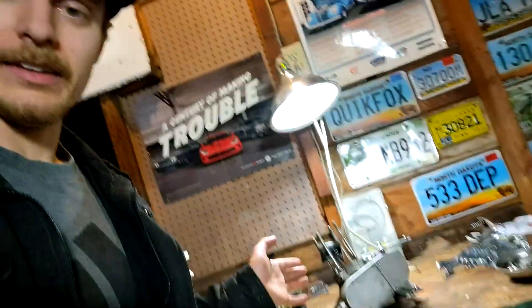That's the end of the show, and that's also the end of the series for testing this Phantom 85 to see how long it would last. The answer? About 25 to 30 miles after the piston swap. Granted, this maybe wasn't your typical use case, but it just shows it's still not a super reliable engine yet. Anyway, I still have a carcass of an engine — the bottom end seems okay. It's probably going to need a jug and another piston. I've heard rumors that there's some better ones out there, but I don't know if they are any better. Maybe you can find out and do a video on it yourself and I'll link to your video.